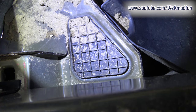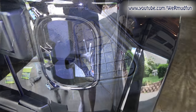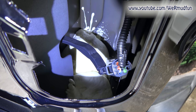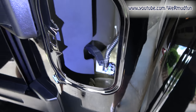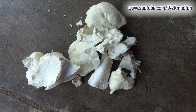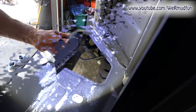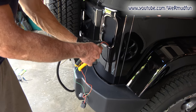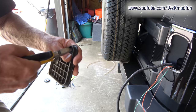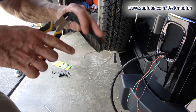To gain access to the passenger taillight compartment, we have to pop out this plastic piece. We still have some mud from the Go Topless event. We took the taillight out, and there's a lot of Great Stuff in there — in case you're wondering, that little piece there is the stop for your rear door. We're going to have to notch this plastic to get the wires to come through, otherwise it would crush them or not sit well. I'm going to cut a V right at this corner, enough to get the wire through, and come up on the top of it too.